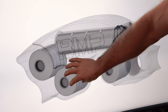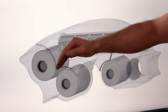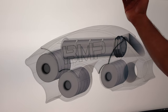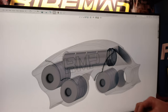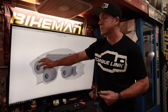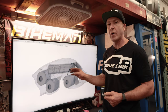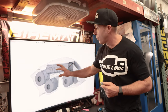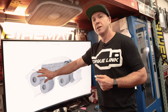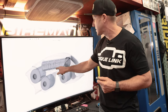If we want the weight down low, we can put the weight down low and have that weight not have a lot of load — let it rev up and then slingshot grab after the horsepower is being made. That works extremely well for turbo sleds. With the weight towards the tip, we can change the whole dynamics of how heavy that weight acts. Even though the weight only goes to 90 grams, by having the weight stacked way out to the tip we can make this weight act like a 106 gram weight, just because of how much further that center mass is out from the pivot.